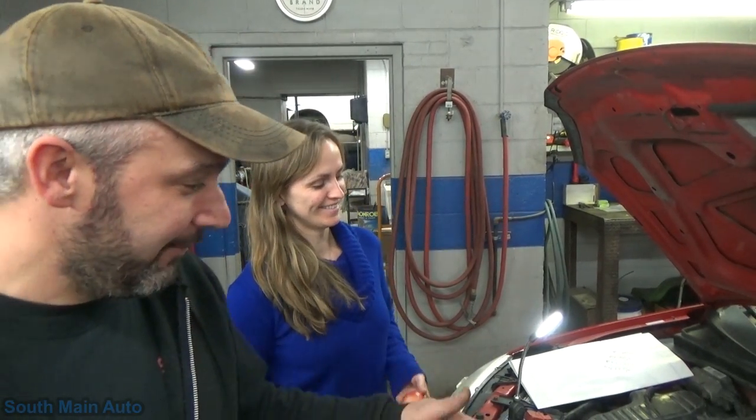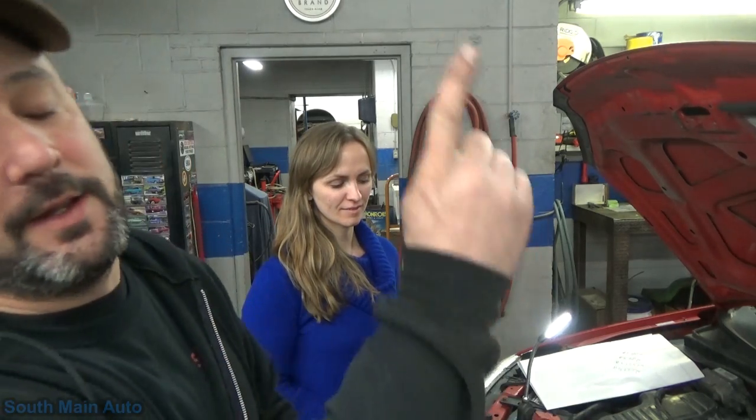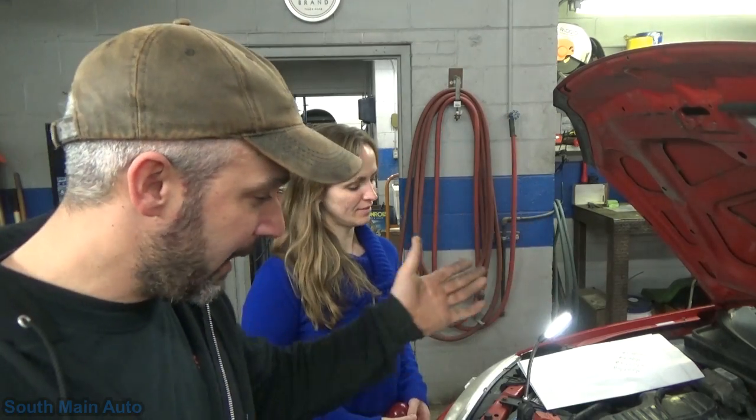The Civic — it's broke. It's blown cylinder to cylinder. It's leaking out the intake as well, which doesn't necessarily mean it's the intake valve, because while cylinder one is on compression, cylinder two may have an intake valve open. It's leaking cylinder to cylinder out the other valve, out the throttle body. The main reason we wanted to do this is to make sure it wasn't severely blowing out the crankcase.